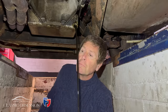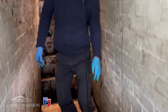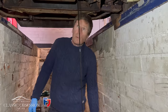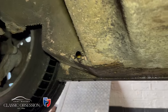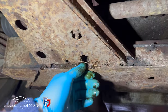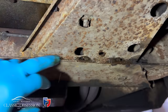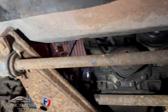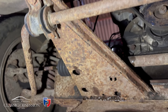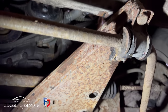That smells of fuel, so it was definitely due. And whilst I'm down the pit, I'm going to take the opportunity to have a good look at this chassis and see its condition. These wells here are one of the first things to go — it's where water accumulates and they eventually rot out. There's surface rust which is clearly evident, but looking at the rest of the chassis, most of it is surprisingly solid.